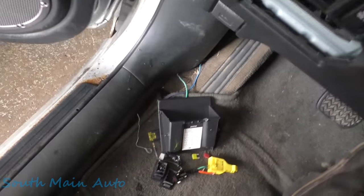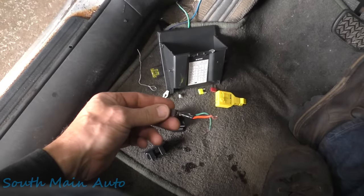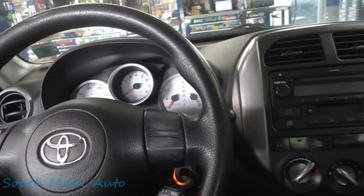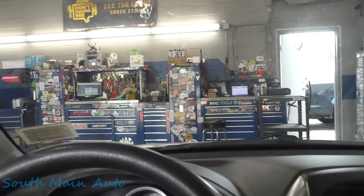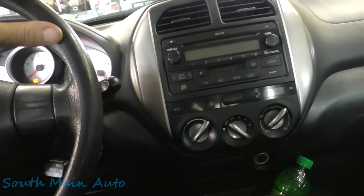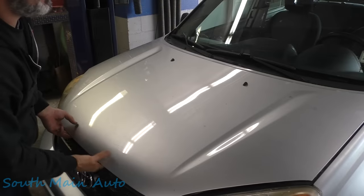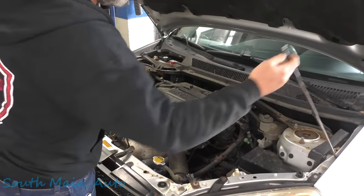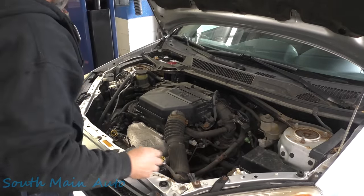That stuff down there gives me a little concern. It's a little micro switch, some sort of bunch of fuses. We do have four-ways — that's one working thing — but no turn signals, none of that. Let's just pick something and fix it. Maybe pick the radio. Before we do that, let's give a little visual inspection here, make sure it's not like a battery cable hanging off or something silly. It's got to be a big main fuse or main power feed, I would think.